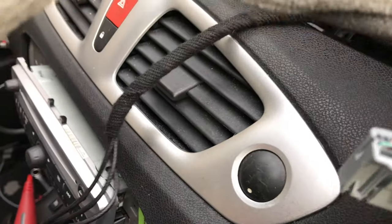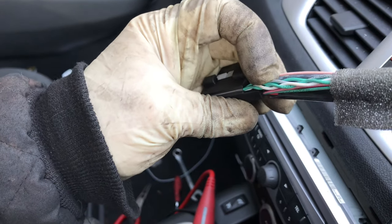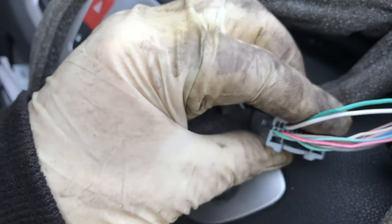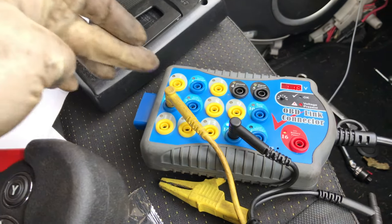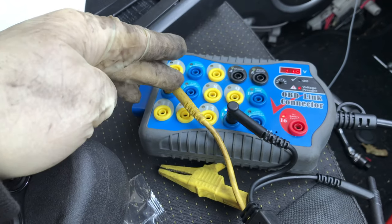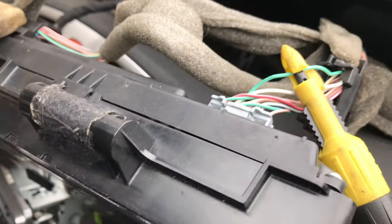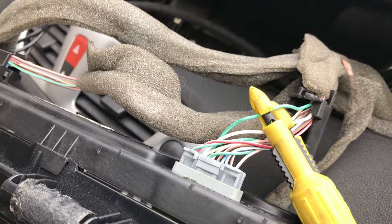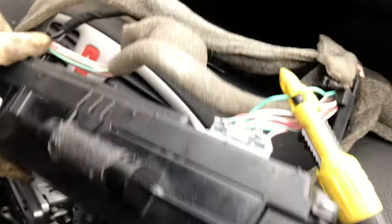The other multi-plug that's got the CAN wire on it as well — I think that just goes right out to the radio. I don't think we'll bother ordering an instrument panel when we don't have any CAN bus signals present. What I tried was taking from my DLC box pins 6 and 14 and going in through my probes into these wires here to do a bypass test — see if I could get CAN communication coming back up in this instrument panel. But sadly there's no response at all.